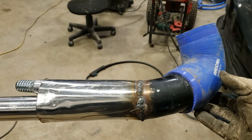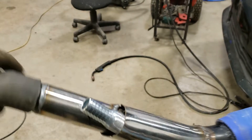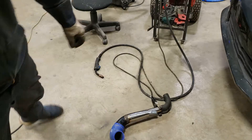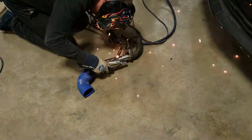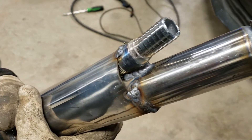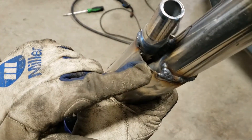Here's what I mean by adding another hose barb where they join — that little guy is three quarter inch, so he's going to go up to that heater hose coming off the frame rail. I gave it a bit of a kick out so it's pointed towards where it needs to be. I'm going to go ahead and tack it into place, do one more mock-up, and then weld it up. I wanted to make sure I welded that three quarter barb as much around it as possible, and I'll tap the sides in and then fully weld it up in a way that never leaks.